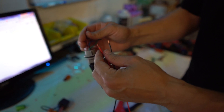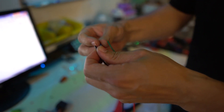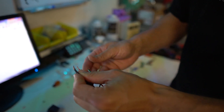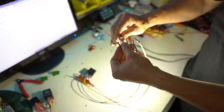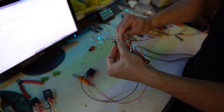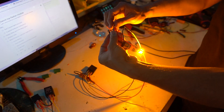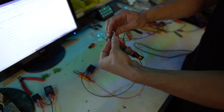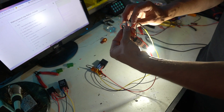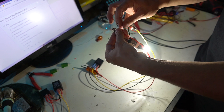So we can test it really quick again. I know that this happens to be the ground wire for this setup, so I'll twist those two together. I know that the power wire for white is right here — I can hook that up separately as well. And then I can hook up our load. I'm going to hook up our ground connection. Now if I want, I can test the white — I see that the white works fine. I can also plug this thing directly into our turn signal without white connected, or I can do both.